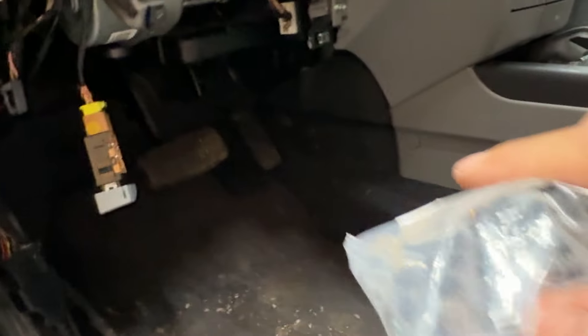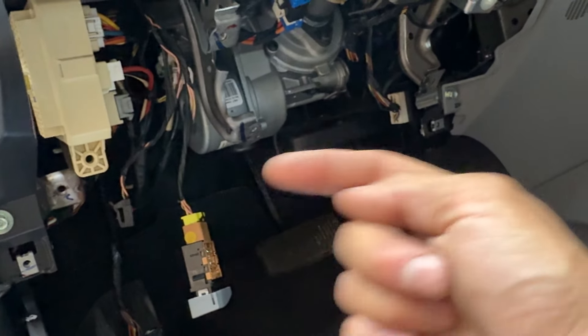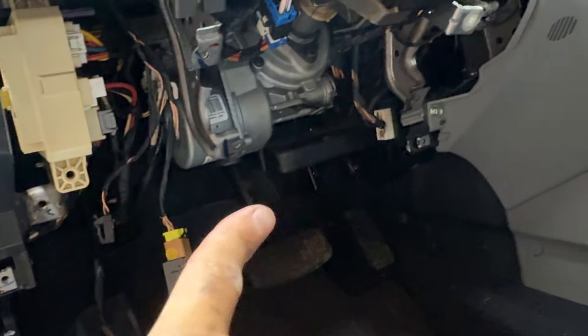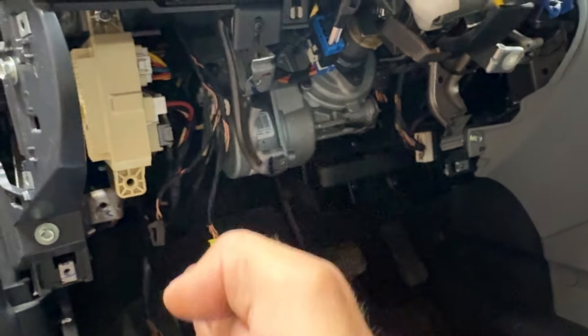Here's the deal. When you get in there, you've got to clean out — this one is going to be literally just oil-impregnated rubber dust at this point. Pull that out, clean everything really good. If I remember correctly, the female side of the brass bushing aims at the motor, and the male side goes into the spring. So it goes: spring, brass bushing, then motor.